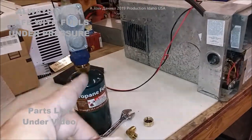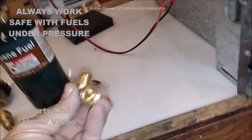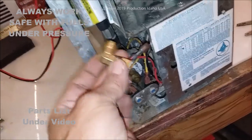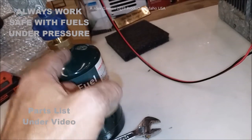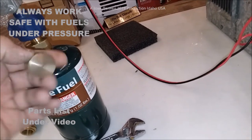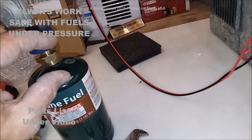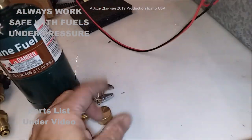This bottle is hooked up and piped in the same standard three-eighths. If y'all have never seen these before, I'll put a link — these are about ten bucks, but they're worth their weight in gold. It's a 90-degree fitting with a free-floating nut on it for a flare fitting; it is amazing how well that works to pipe things up. Be sure to get caps, because once you start to refill these they will occasionally leak — the speed of fluid going in and out can cause the rubber to deteriorate on the piston seal, or Schrader seal that's in there. Get one of those caps and put it on firmly and they won't leak down.